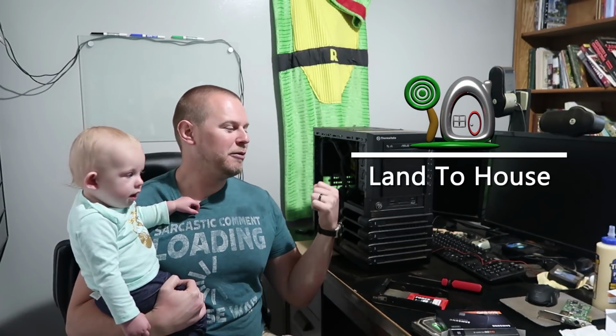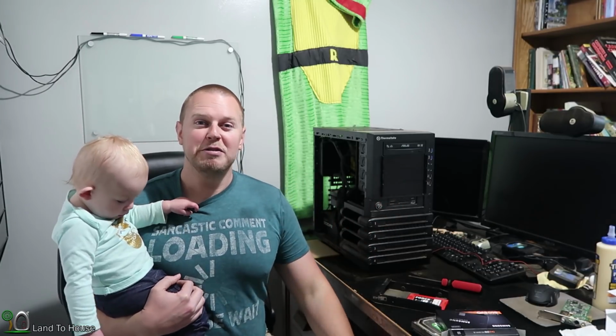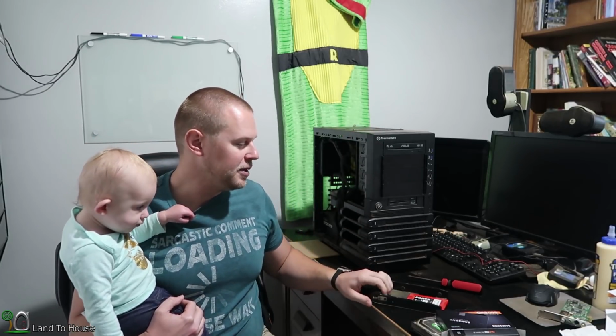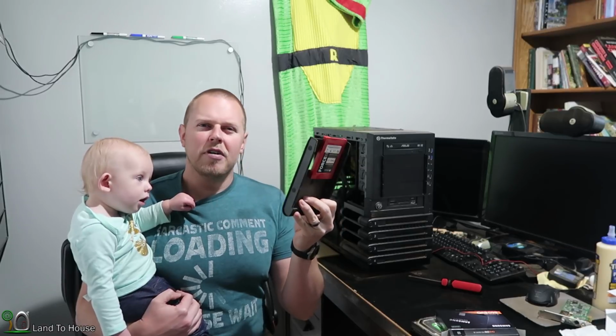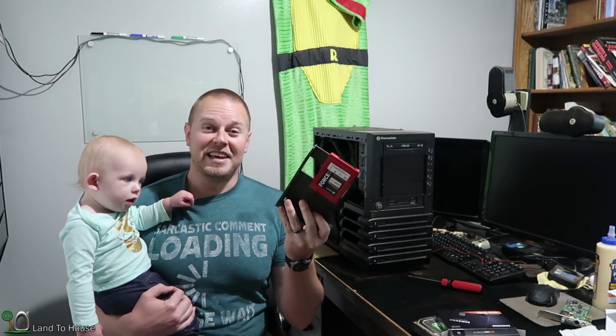So last week I was working on my computer and the colors inverted on the screen and everything locked up. I was pretty bummed out about it, and it's not worked since. But after some troubleshooting, I have determined that my SSD with the operating system on it has, well, it went from NTFS formatting to RAW unallocated.